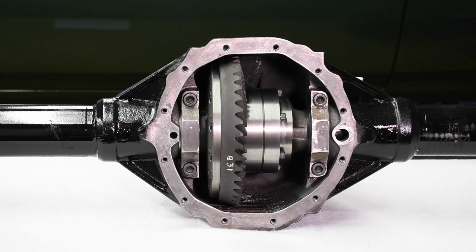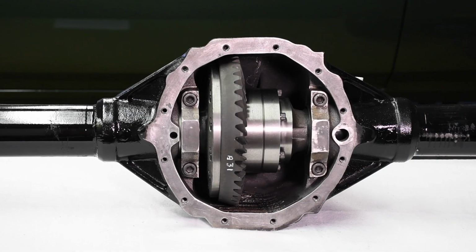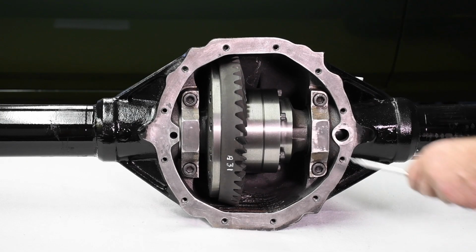Mark Williams starts with a custom engineered case from DTS. This setup takes all of the 12-bolt shortcomings and fixes them. At first glance, the housing looks like a conventional 12-bolt, but looks can be deceiving. For example, the area behind the rear caps in a stock 12-bolt casting is more or less hollow. It's the area back in here. This obviously compromises strength. With this housing, the area surrounding the caps is solid. The caps are much larger than those found in a stock GM casting.